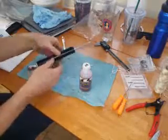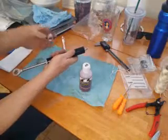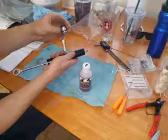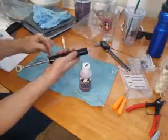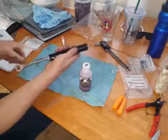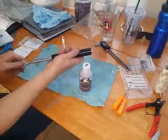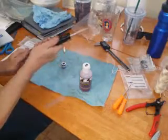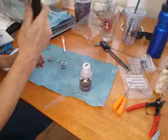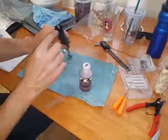Basically, what I have done with my damper now is I've gotten this part back together. This seal mechanism that sits on the end is inside here, and I got my end on with the blue Loctite. What I'm going to do is push that rod all the way down and fill that tube up with oil.